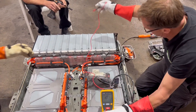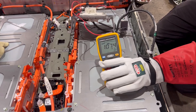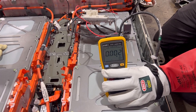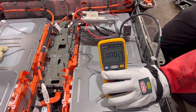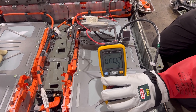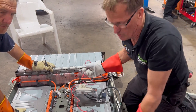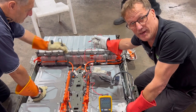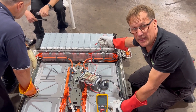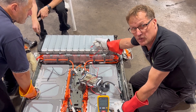Going to our third battery pack at the back — it's a bigger pack, but the resistance should be the same. Pressing the test button — we wait a moment, but straight away it's not applying any voltage. It's reading 0.002 megaohms resistance — very, very different and much lower. It's already sensing a bad leak, so it's not applying the 1,000 volts across the circuit. This pack clearly has a bad insulation fault. We've isolated that, and now it's a matter of getting this pack apart and narrowing down to which actual cell has the isolation fault.